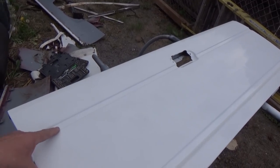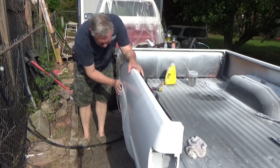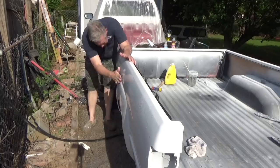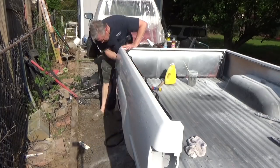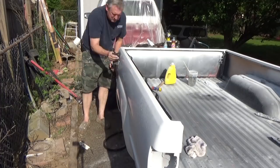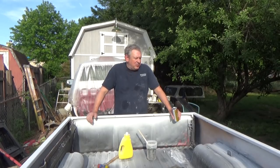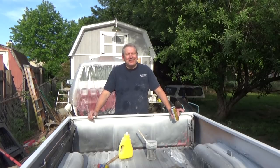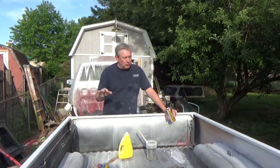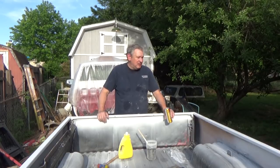Having to get inside this is a pain in the butt. I've been out here getting wet — my hands are all pruney. I've been wet sanding a lot. It looks really good. I'm going to let it dry, then we're going to look for imperfections and fix those, then we'll be ready to do the 2K primer, and should probably be ready to paint.